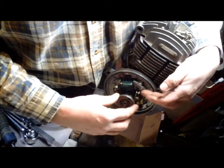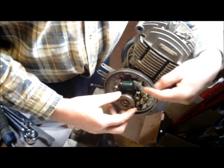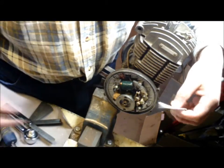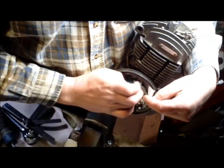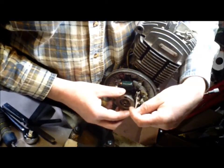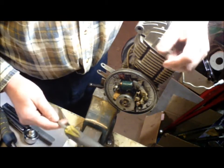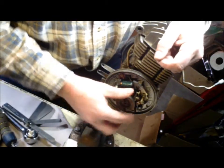What you want to do is rotate in the clockwise direction — rotate your cam until you see those points just starting to open. Right at that point there. Make sure they're just starting to open. Here's the trick: if you take cigarette paper, cut yourself a little strip of it, put it up to the points, put it in there. If you can pull that cigarette paper out without it tearing, that's the exact point you want it at. Now, to grip this onto the cam, I'm going to give her just a knock with the handle of the screwdriver blade. What that does is it pushes the tapers together and it should be solid as heck. And it is. That part's done.